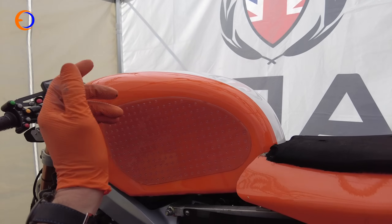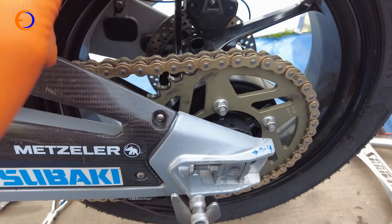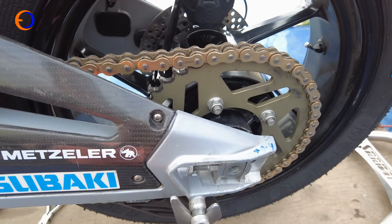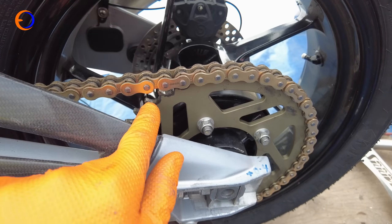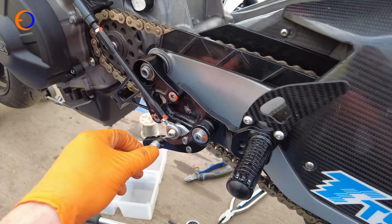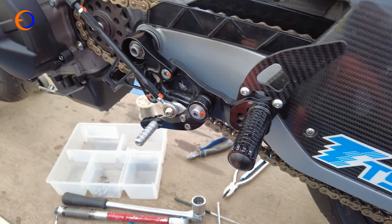With my fuel tank back on and the four litres of fuel back in it, I'm moving further down to the back wheel and the chain. Chain maintenance is really important especially at TT — lots of people break chains, so making sure it's maintained and at the right tension is critical. I'm going to spray a load of cleaner on the chain; I'm using GT85, though you can use something like Motul chain cleaner. I'll spray the chain liberally, go around with some rag to clean all the old dirt off, and once it's nice and dry re-lube it with some Motul chain lube. This also gives me a chance to check for wear on the front and rear sprockets, and while I'm around this end I'll double-check nothing is coming loose on the gear change parts — if your rose joints go a little bit tight and don't rotate freely they'll try to undo the bolt, which is why you quite regularly see gear linkages falling off.